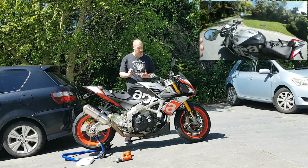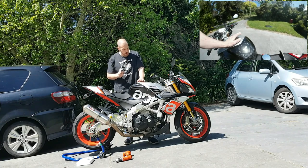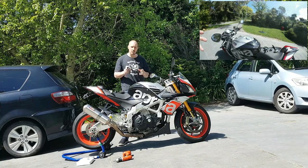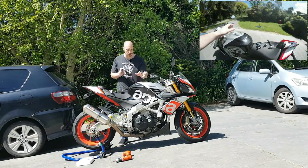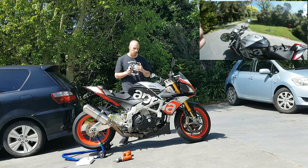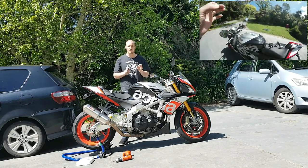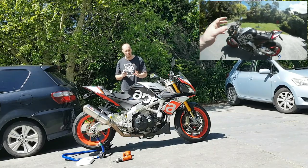Because I've hit 40,000 k's, I'm going to have to consider getting a valve clearances check. On the Aprilia, it's every 20,000 k's, and it was last done around 20,000 to 25,000 k's by the previous owner. The dealer said I've got somewhere around 5,000 k's to play with, but I need to start thinking about it. I've looked at Sean Nielsen's videos — check him out if you haven't, he's really knowledgeable on the V4S from a mechanic's perspective. He has a two-part series stripping the bike right down to check the clearances with some really good tips.